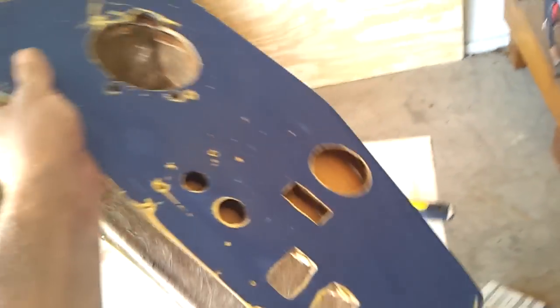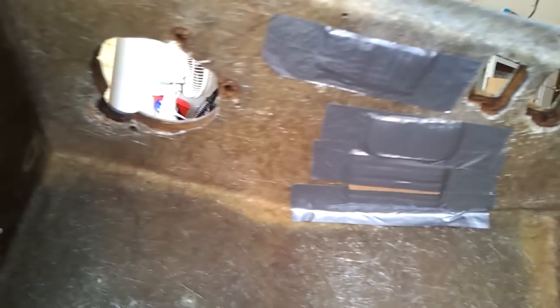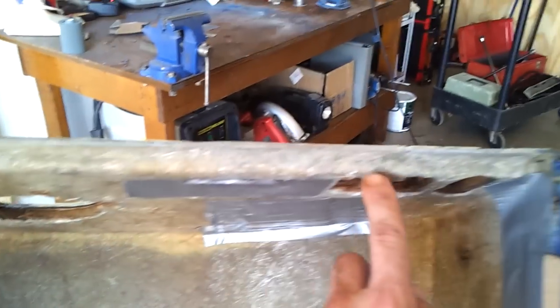What I did was use some tape and on the back side, I just taped cardboard panels to the inner skin, blocking off the holes I wish to fill so the filler can build and not fall back down into the inside. As you can see, it's in pretty good shape on the inside — no structural cracking or coming apart. The back panel and front panel here, and the tie-in with the plywood backing, is solid and has not come apart.